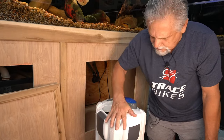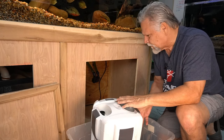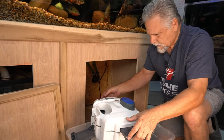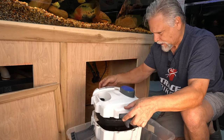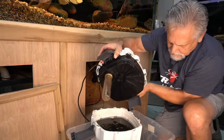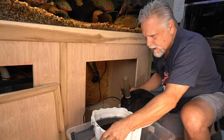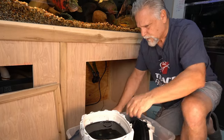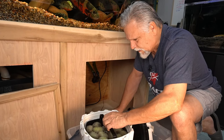Let me dump this water out and work on this inside the Rubbermaid. Now, this unit should have a suction so that when I pull it out you hear a suction sound, and I'm not hearing that — so obviously that was broken somewhere. The motor section always holds a lot of water, so you always have to make sure you pour all that out first. And if you have a UV light, be careful because they'll break if you hit them against anything, and then you've got to go hunting on the internet to find a replacement. Just like the Fluval, the media isn't that bad. The pre-filter over the intake is doing a pretty good job.